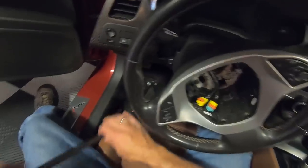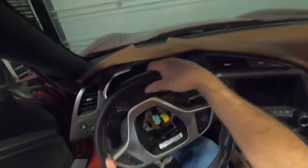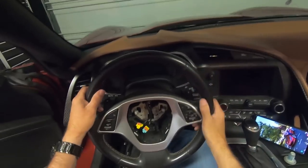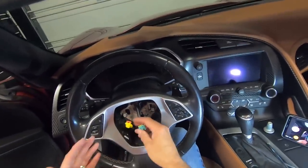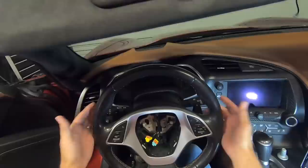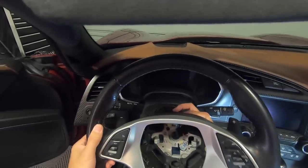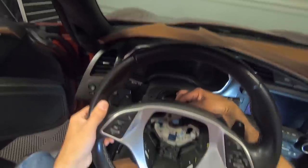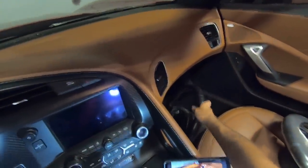What I'd recommend doing is putting the steering wheel back in the centered position so we have a guide. When we take the steering wheel off, we make sure we get it right back where it belongs. That looks straight — okay, that's straight. So at that point we should be able to remove the steering wheel. Now that all the connections are loose and the bolt is out, the steering wheel is straight, and we should be able to just pull this thing right out — and it came loose just like that, no prying at all. Just be careful and pull these cables through the other side; you'll have to twist them sideways and that releases the steering wheel.